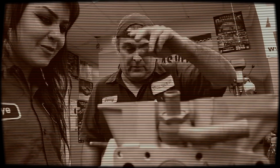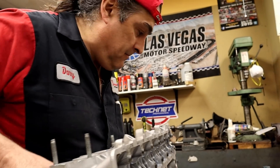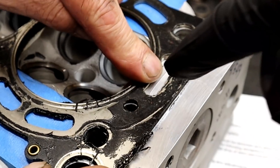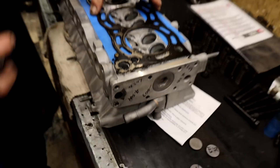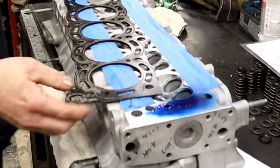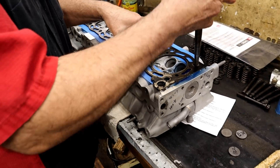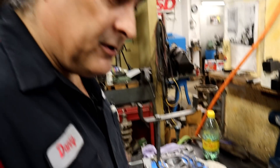Okay, so we're clean. We're going to set these aside. Then we've got the head gasket — there we go. So, no water. We're going to do that, and if you didn't have this, you could use blue tape across it. But we have this so we're going to use that. I like to use the head bolt holes — these are our dowels, just like you had on the thing. And now we can scribe right there.